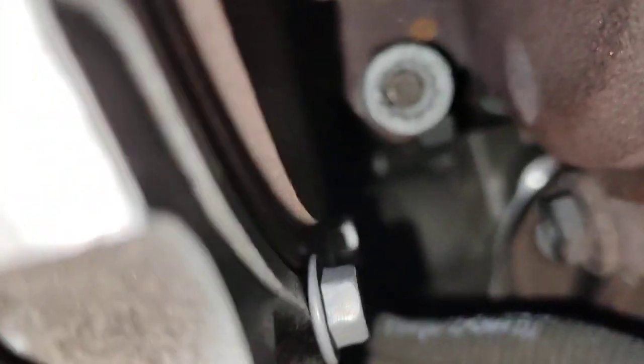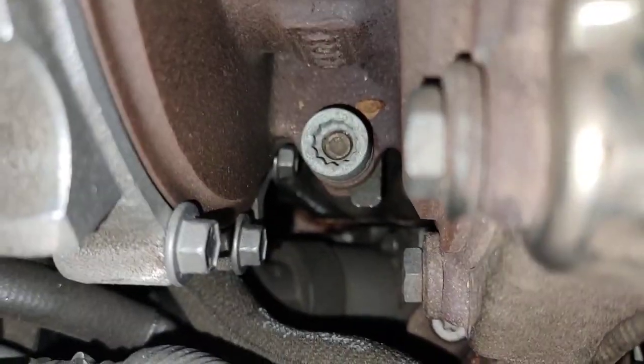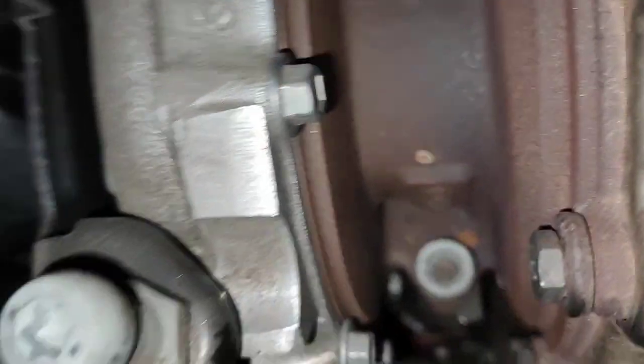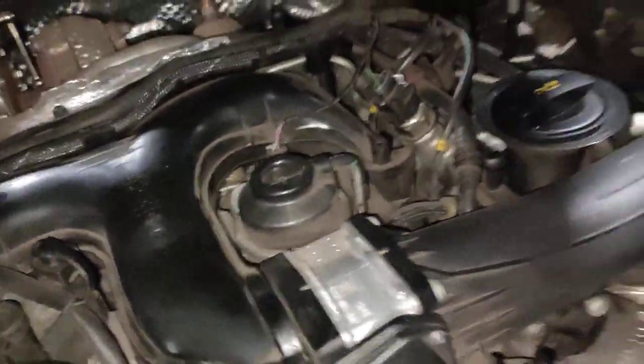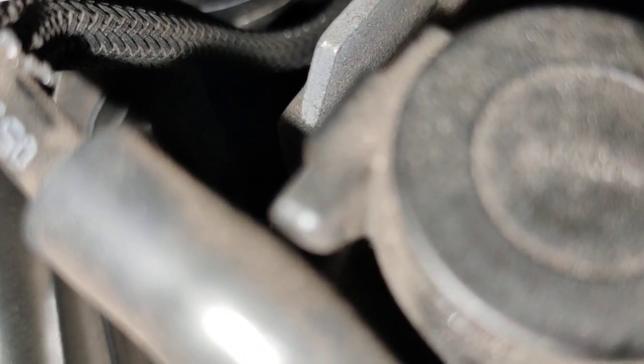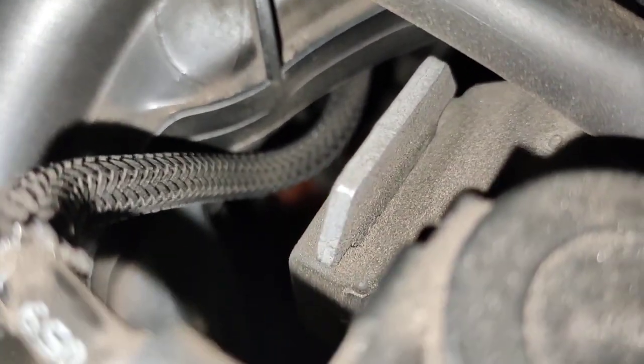Let me go on top and see if I can show you what I mean. It's really hard to see. There were marks there at the bottom, around here — red. That's cooling as well. Looking at the front, to me it looks like it's leaking coolant from the actual EGR cooler, or the actual vacuum supply line.